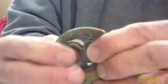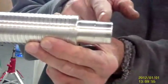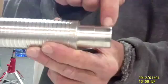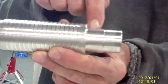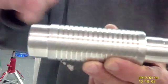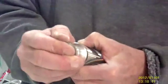It'll almost look like a heart when you get it in there, and then ride it up to the top. Then come back with a bearing sizing tool — this is one of the new ones from the GPA. We have room for the 902-013, the aileron bearing. This is for the oversized bearing, and once you've gone oversized there's no more oversized you can go. And finally, this is for the flap bearing on this end, and it also does the flap-2 bearing up on the front as well.